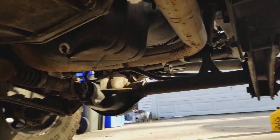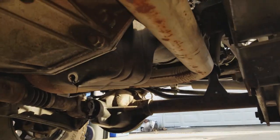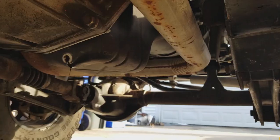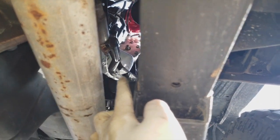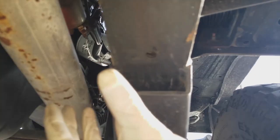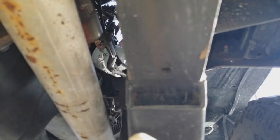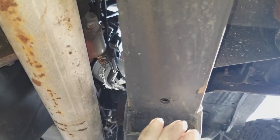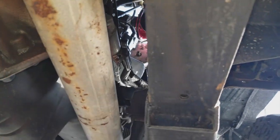It's been around five minutes and the oil is still coming out a little bit but barely anything at all. You're not finished yet though — you still need to change the oil filter. It might be easier to unscrew it from the bottom about 50% of the way, then go up top and unscrew it all the way. Unscrew it 50% from the bottom because it's easier to get a hold of, then finish from the top.